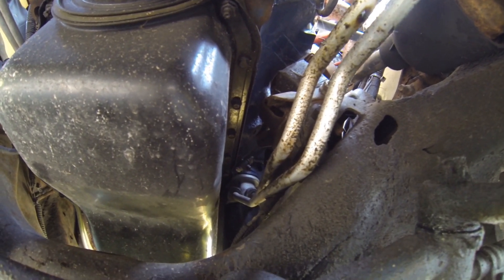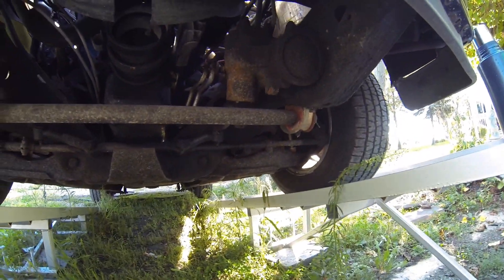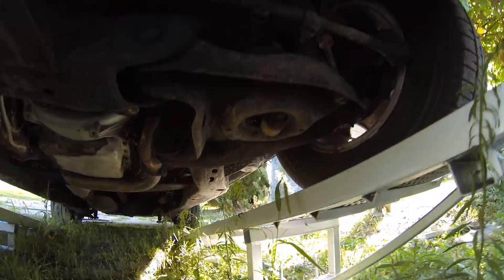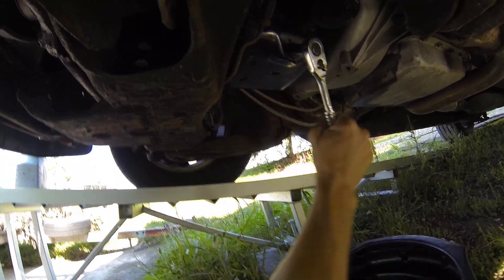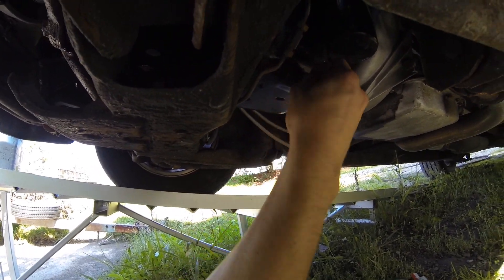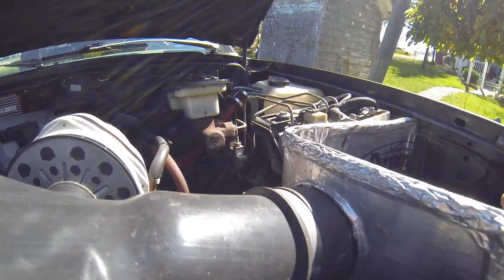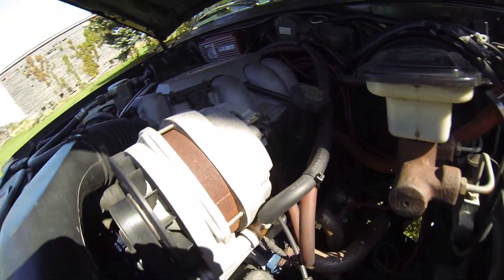I think the cooler comes right off the block and then I can just bolt the filter straight up to the truck. I don't really do any heavy towing, and I don't do extended spirited driving, so if I can eliminate that oil cooler, that's gonna solve my oil leak issue right off the bat. That's what I'm attempting today. Looking from above into the engine bay here, we can see these lines are all caked with oil.